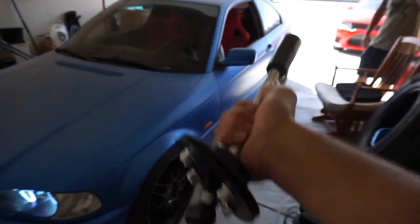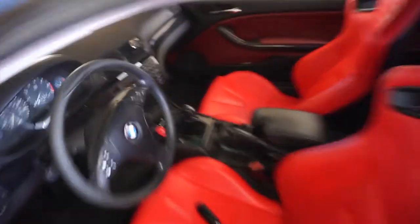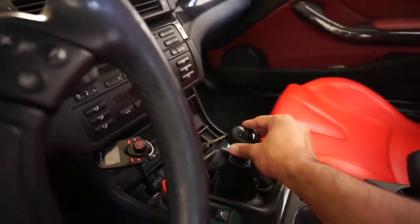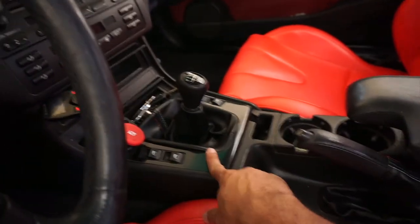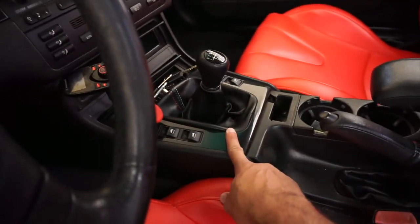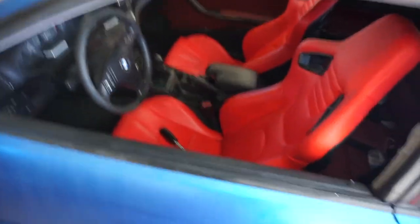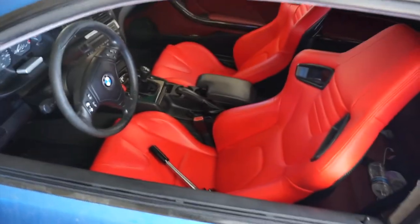First thing first, you're going to have to pull up that shifter right there. It's actually hot in California again. You just pull this up and it comes out. Then there's like one, two, three, four clips — pull this thing out. Then there's the rubber on the bottom, take the rubber out. Then the next thing: jack up the car, get under the car, open up the clips and get the thing out. Put the new one in, you got four bolts, clip it in front and bottom — you got the whole thing working. That's basically how you install it.